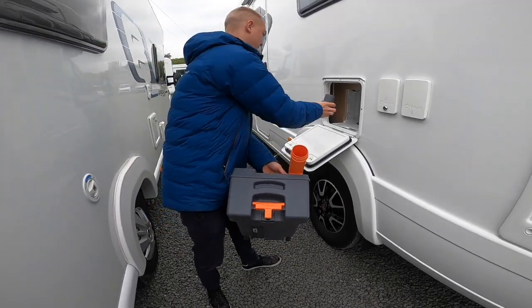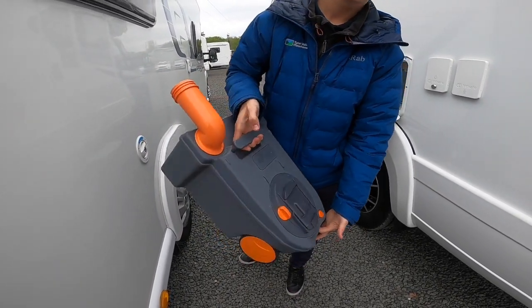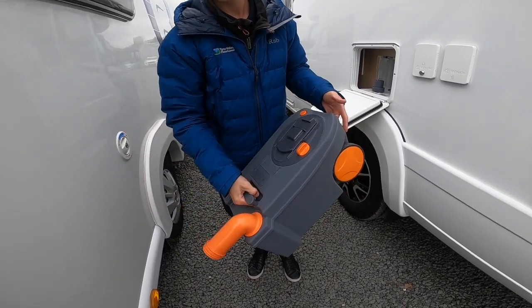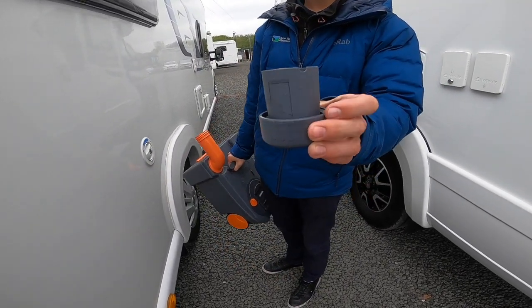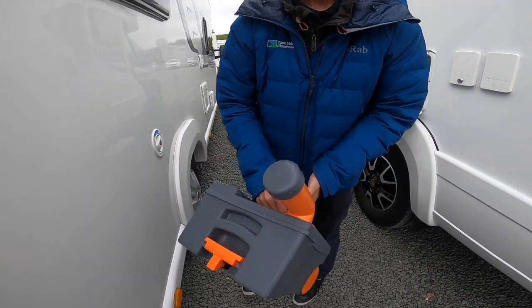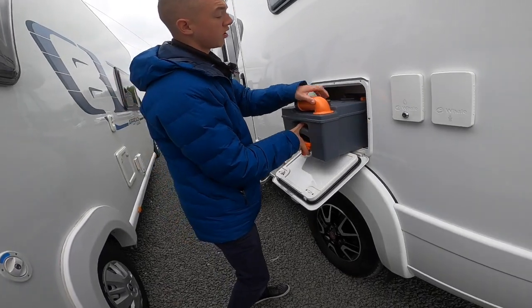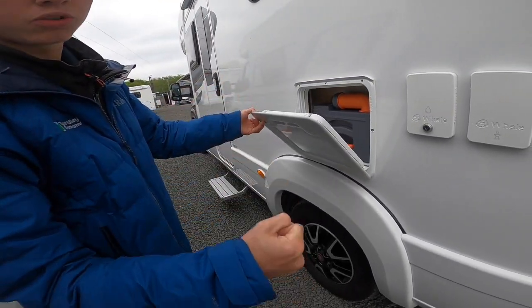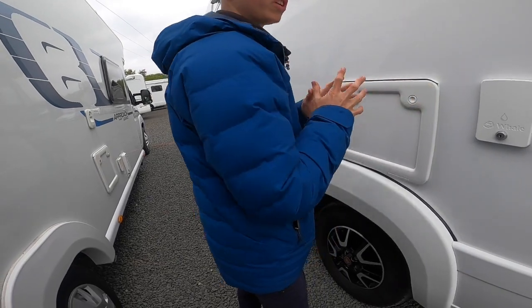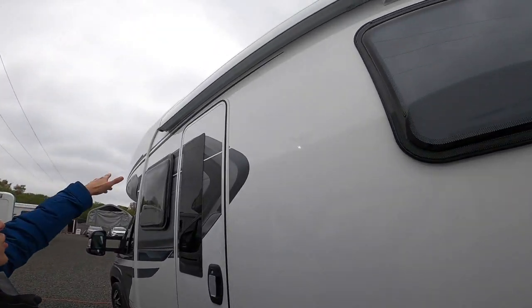Remove the grey cap, press the orange button to help when pouring the contents out. Pour it out, put some water back in for a rinse and tip out again. Then go in with a capful — 120ml — of your chemical, which is either green or blue depending on what the site prefers. If using tablets, put a pint of water in or put the cassette in completely dry. Add a pint of water, open the blade, drop the tablet into the toilet — it's in cellophane format but you don't need to remove it as it degrades with the water.